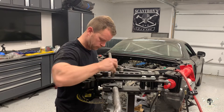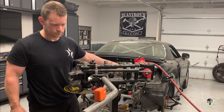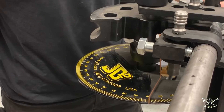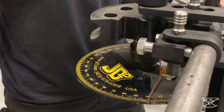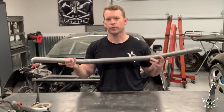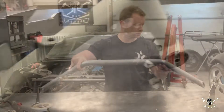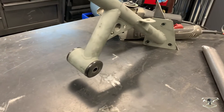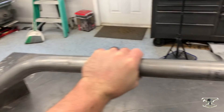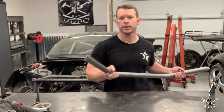Now setting up for the second bend after measuring — this will be an additional 40-degree bend. Here is the crossmember all bent and trimmed up on the sides. The way I found the angles was by making a quick template based off of the original K-swap subframe, which helped me cut these angles. All that's next is to put this in the car and tack weld it to the plates I already have on the vehicle.